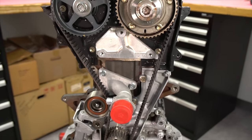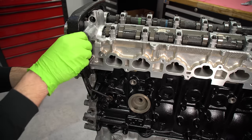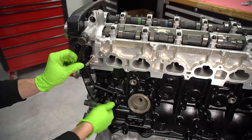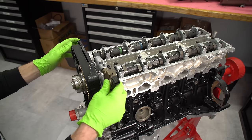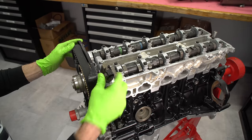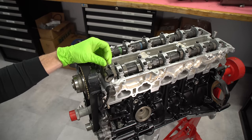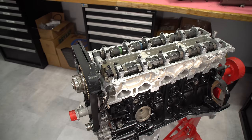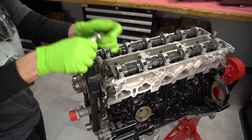This is the oiling for the variable cam. It pulls oil from the block and it goes up into that cam cap, and from the cam cap it goes into the variable cam solenoid. The way the variable cam works is the computer sends power to this little solenoid, which then duty-cycles a certain amount of oil into that cam gear. Depending on that duty cycle, it can actually change the location of that cam gear relative to the cam — and by doing so, it can change the location of the cam relative to the crankshaft, essentially changing the cam timing.